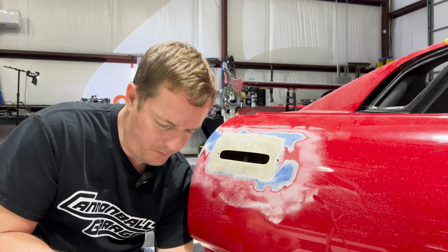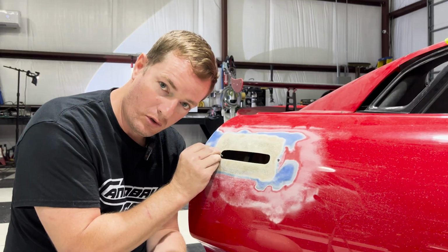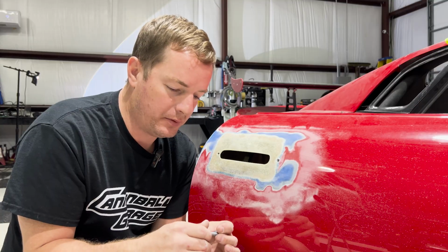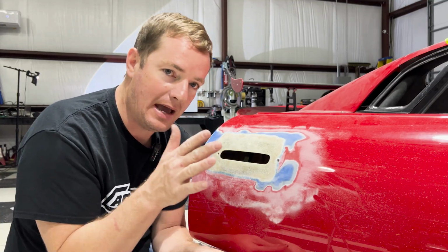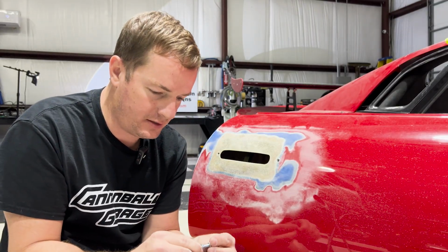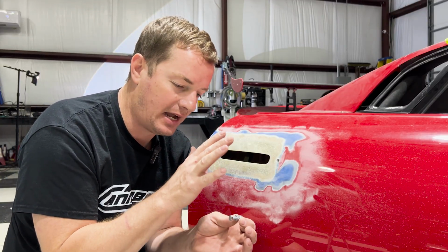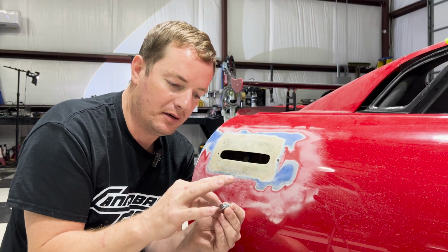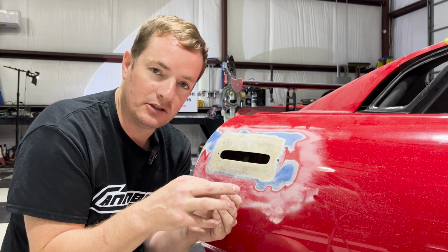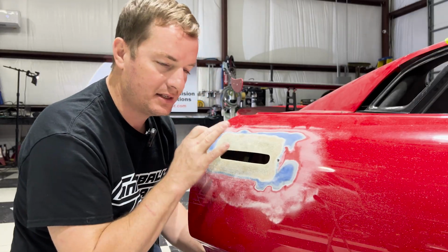Anyway, what I'm gonna do is take this nut right here and put this bolt through this hole, bolt it in from the backside. That's not exactly how I'm gonna make this work. What I need to do is be able to adjust the height or the depth of this handle. So I'll take one nut, put it on, and then the second one will be the one that holds it in place. Now when I put this handle in place and I know it's exactly where it needs to be, I will probably take a bit of blue Loctite or something like that and dab it onto this second one so it'll stay in place. Let that dry, let it set up a little bit, come back, and then when I tighten the bolt down, it will tighten and hold the handle exactly in place.